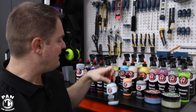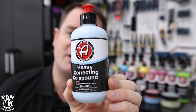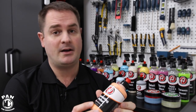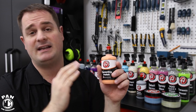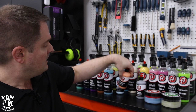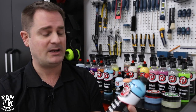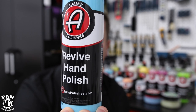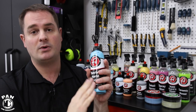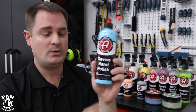Adams has their own polishing compounds. They have their Heavy Cut Compound — this is the correcting compound for deeper swirls, scratches, and oxidation. You follow that up with a paint polish, their Correcting Polish, which is the jeweling step to add gloss, depth, and clarity to the paint and remove any marks left over from the compound stage. When you're done with paint correction, you want to continue prepping the paint properly. Adams has their Revive Hand Polish — a pre-wax cleaner you can apply by hand or with your DA polisher to remove any leftover previous waxes or sealants and properly prep your paint.